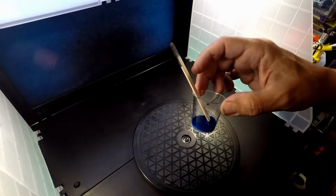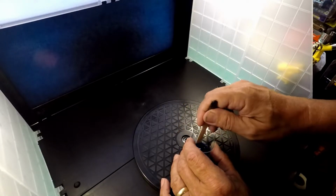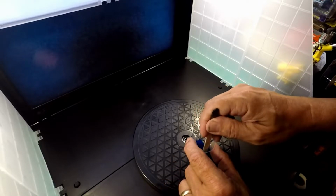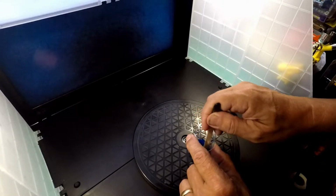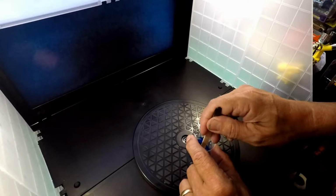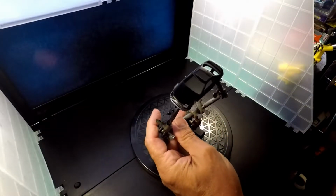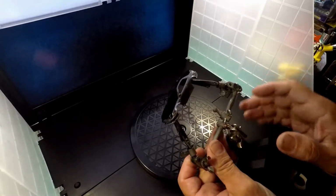And if you're wondering where I got these little teeny mixing cups, I got them at the Dollar General, I think it was. It was either there or Dollar Tree, I can't remember. But anyhow, it probably wouldn't work too good for solvent-based paints, but for these water-based paints, it works perfect. I have had no issues, and I'm painting quite a few cars now. Just mix it up. You don't want to over-mix it. You just want it thoroughly mixed, and then you stop. All right, here we go. You can see the lightness of the base coat. When I turn the light on for the paint booth, you'll really see it.